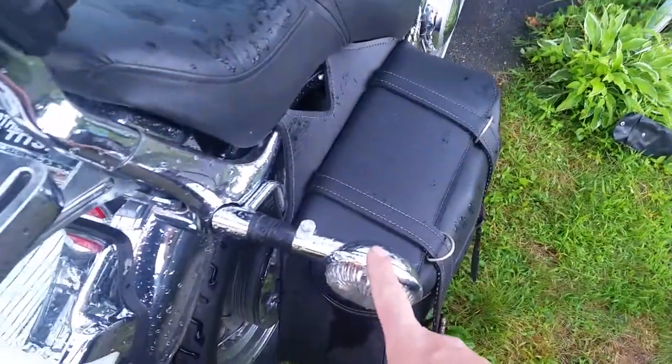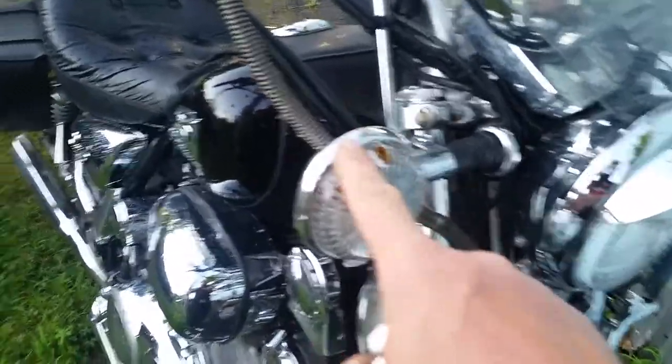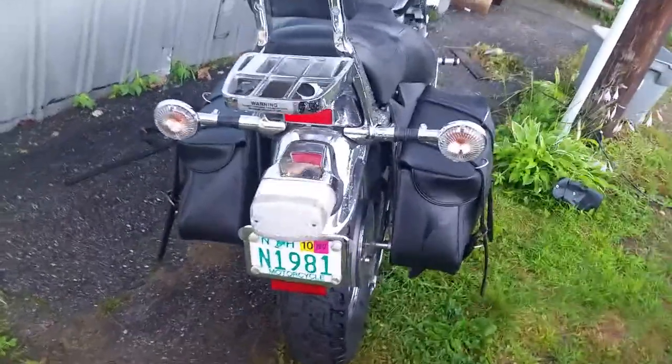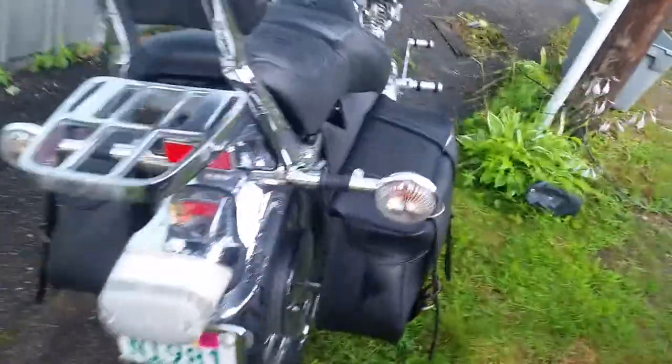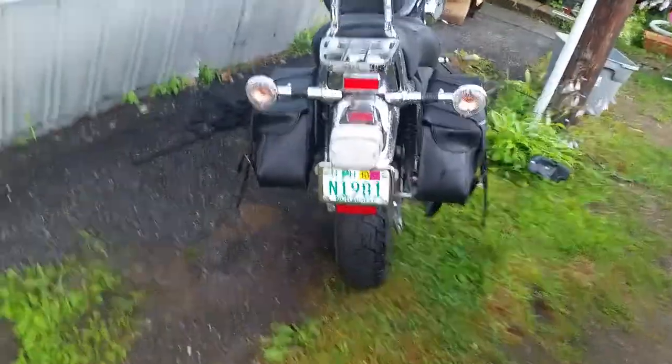How did I get those to light up? Normally these are only single-filament — they take 1156 bulbs. Not on this bike. These are 1157 bulbs — double filament — because what I did was I took a set of front directionals, grabbed an extra set, and mounted them in the back. Then I took the regular light wire and connected the two light wires together, bridging them straight across, and the light wire is hooked up to the taillight on the light side. When I hit the brake they don't get brighter — they just stay on; they're on the light wire, not the brake wire. When I turn my directionals on, it stays on low and then blinks on the high beam part.